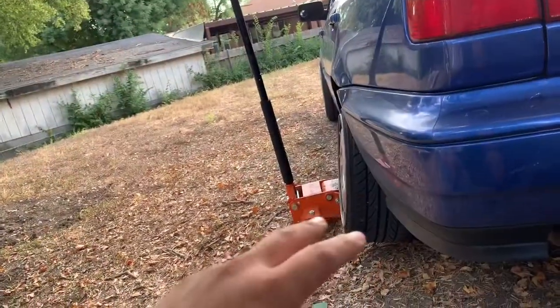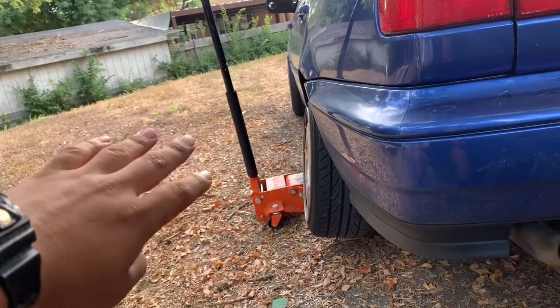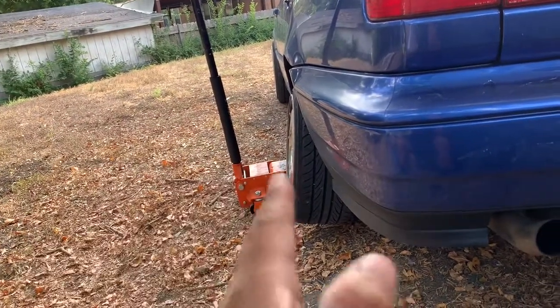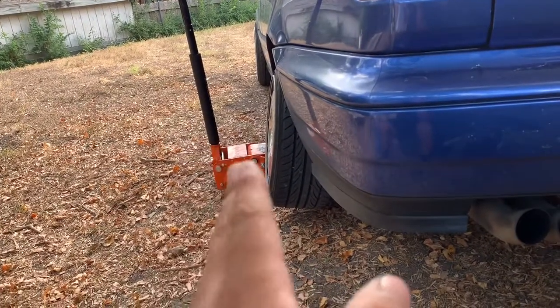So we did run into some issues, and I'm being honest because people just come on YouTube and talk about what they did right and it came out perfect the first time. I can guarantee that's not the case. Remember I added washers to both of the bolts — it's only supposed to be the bottom front bolt that you put washers on. And I guess that's why it's tilted more towards the front, and maybe that's why my toe's out.